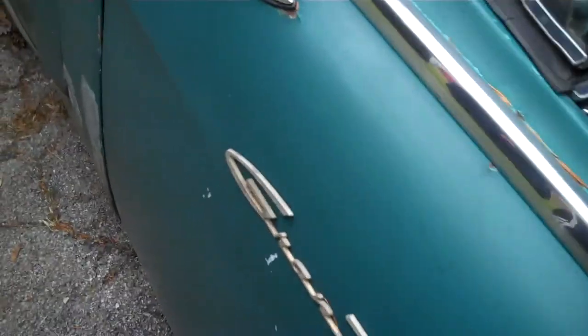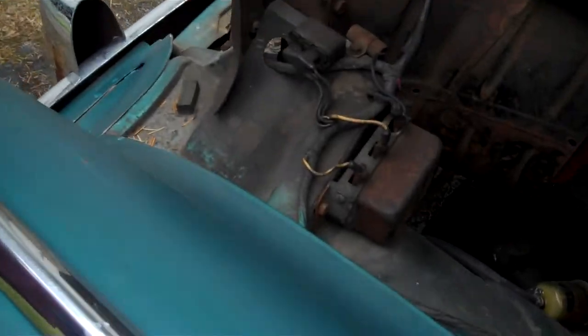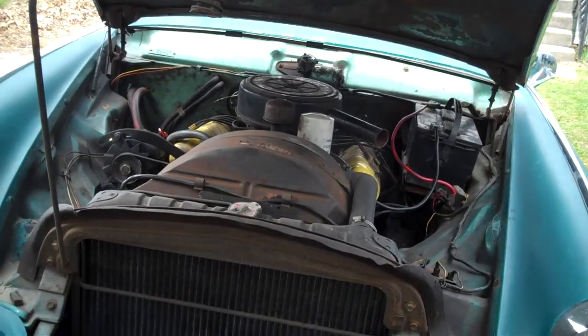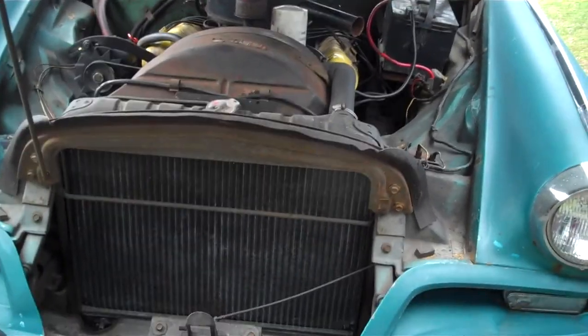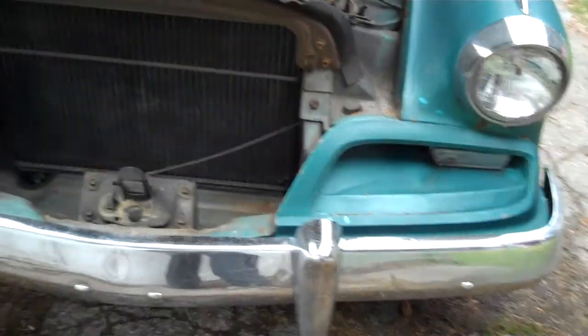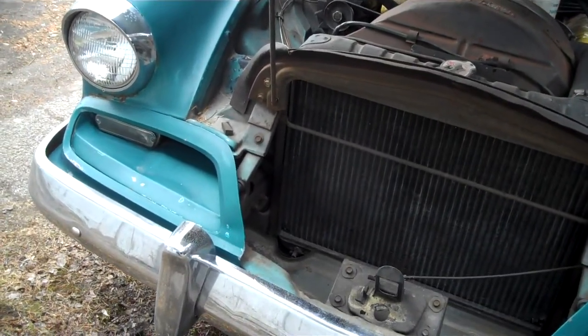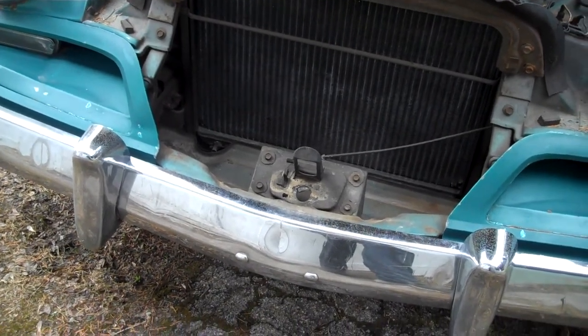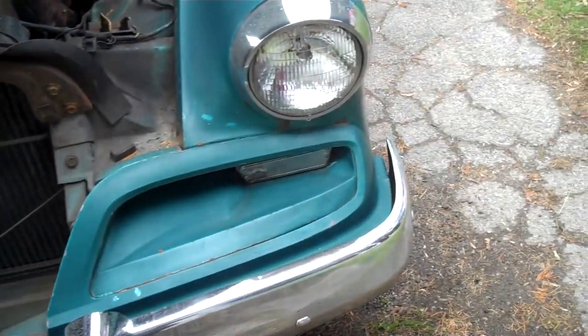It needs a brake system. It basically needs brake work done on it. It needs the master cylinder, which the guy got new, so he gave us the master cylinder for it. I think it needs a rear brake line in the back, which ended up blowing, and it needs another brake line as well. So it needs 2 brake lines and the master cylinder put in for the brakes to work.